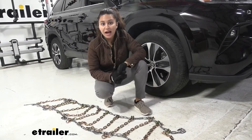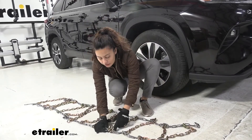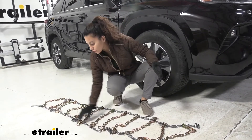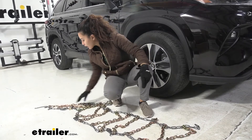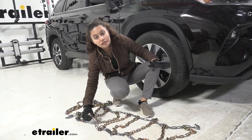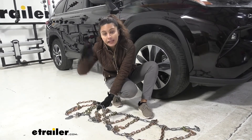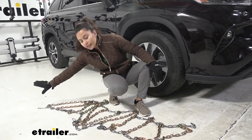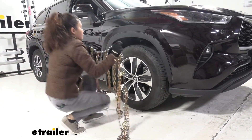Before I start my install, what I like to do is just lay it out on the ground, spread it out, and check that you have no tangles and that all the links look good, meaning none of them are warped or damaged. I do recommend doing this with gloves on, just to make sure your hands are okay. What you need to look out for is that the chain is facing the correct way — make sure that the flat part of the chain is facing the tire and the hooked part is facing away. We will have our large lever on this end. When everything looks good, you're then ready to pick it up and drape it over your tire.